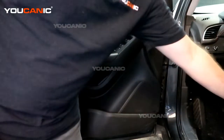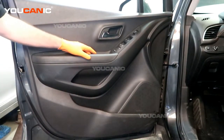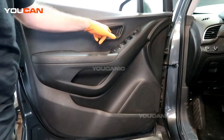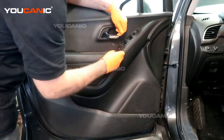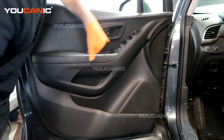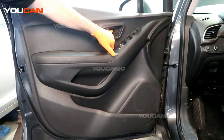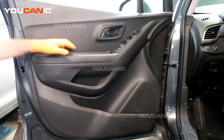To start, there are two little covers we need to remove. There's one little cover here, and using a small pick tool or small screwdriver you just need to pop that little cover off, and that gives us access to the 7mm bolt that holds it on.